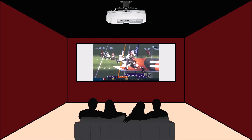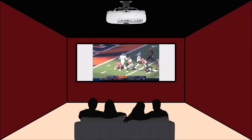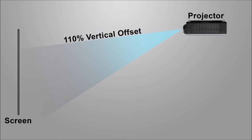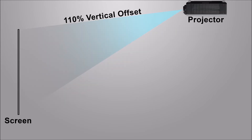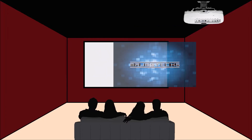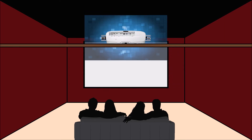Once you have your screen size, you need to determine which projector to go with, since it might have features that work better for certain screen sizes. For instance, certain projectors have a motorized lens which works great for CinemaScope screens — you can set lens memory and have the projector automatically zoom in and out depending on what you're watching. Some projectors also have better vertical offset than others, giving you more flexibility with how high or low your screen needs to be from the ceiling. High-end projectors and some Epson models are popular with CinemaScope setups thanks to their motorized lenses and large lens shift range.